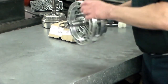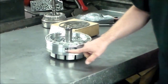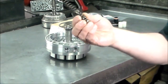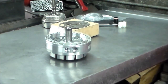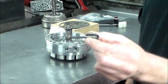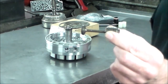This here is what I want to show you. In order to get the sleeve — the plastic tube — out, you take this spring out. Once you do that, you're going to see this flow control valve in here. Take this thing out, rinse it down, clean it all out in there, and just make sure it's nice and free.